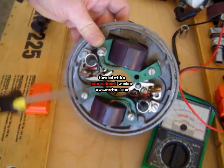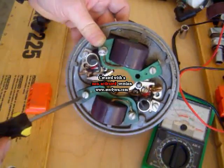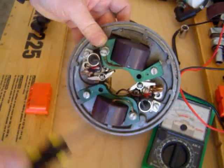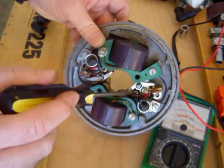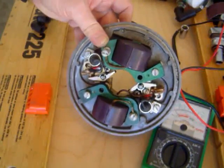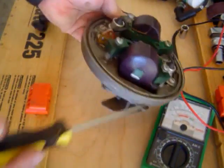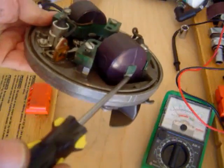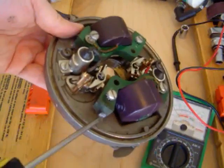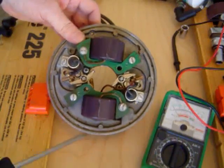Okay, we have these back screws here, the flat tip screws here, here, here, and here. These hold the coil laminate to the armature plate. Remember these screws here and here hold the armature plate to the motor itself. And then we have the laminates as well. If you can see here, the little heel on the coils lines up with the boss along here, and by doing so helps prevent these little heels from rubbing up against the flywheel and causing damage to the magnet.